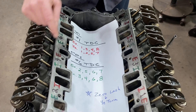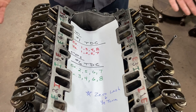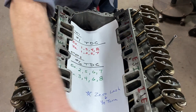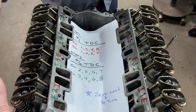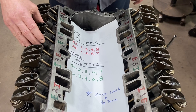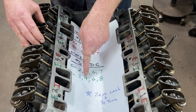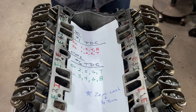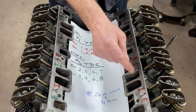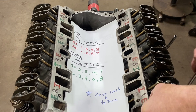That is step number one - easy to do at home, makes things simpler so you don't lose track. Step two: we're going to rotate the crankshaft 360 degrees back to zero, which will put number six at top dead center. Then we adjust exhaust two, five, six, seven and intake three, four, six, and eight. Green labels are step two.